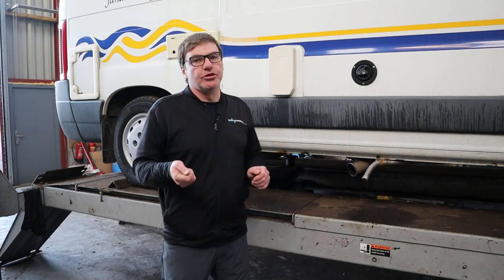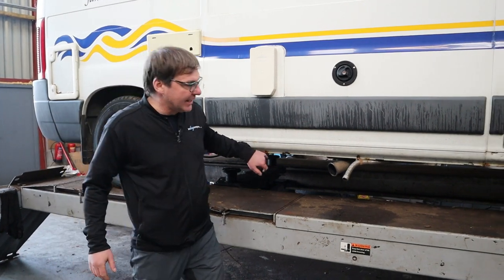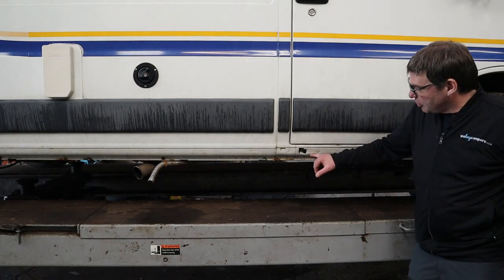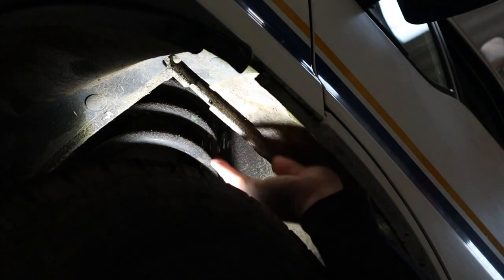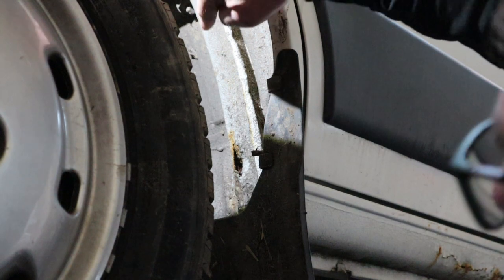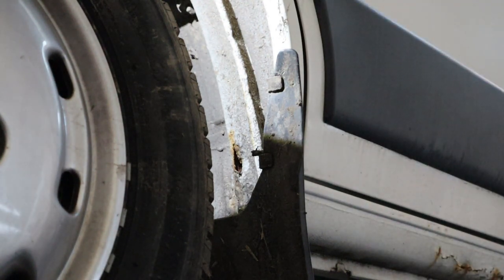On campervans more than motorhomes you need to be checking your sills. As you can see on this campervan, we've got rust here, a bit of rust here, rust here, and what's worse, rust here too. We're going to have to cut this out and weld some new metal back in. One of the most common places for corrosion is under the wheel arches — you probably won't be able to see this on the ground so you'll have to get your hand up inside and have a feel about. As you can see, it's just starting to go here, and down here we've got more serious corrosion — you can see the hole, and that definitely needs taking a look at.